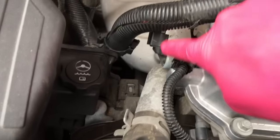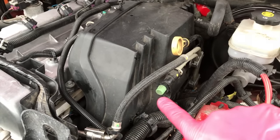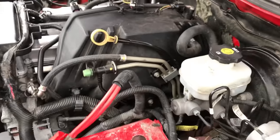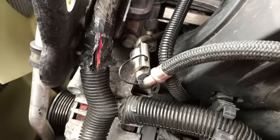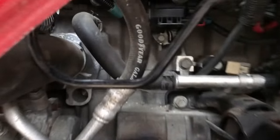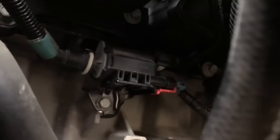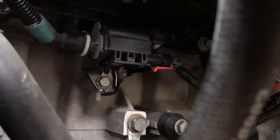There's an additional connection point way down there. From here, we are going to re-secure all the 10mm bolts for the case. After that, we are going to re-secure the alternator and serpentine belt. The intake manifold is fully secured. Those two 10mm bolts right there are secure. You've got two way down in the far corner, two closest to the alternator, and several additional bolts up in there — make sure all of those are secure. Remember earlier we took off that red clip — re-secure that clip and bolt. Verify all of those 10mm bolts are secure.